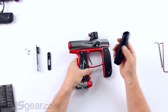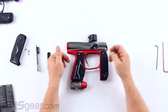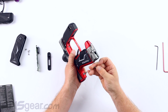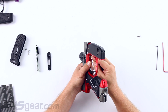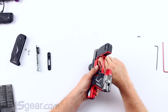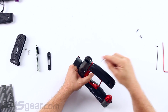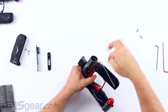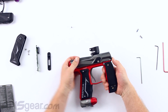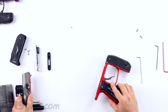I've already got the screws out of that just to speed the process up a little bit. We're going to take all the screws out of this and then separate the frame out as well. You do need to pull the frame off to put the board in—don't try to do it without taking the frame apart; it's not going to end up pretty for you. It's a very simple takedown though, so take that extra 30 seconds and pull the frame screws out. I always forget about this front screw. Now we can separate these—I kind of walk it back and forth, wiggle it up and down until it comes out, and then that comes right off.